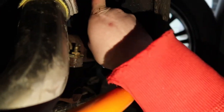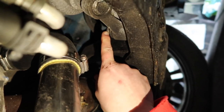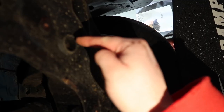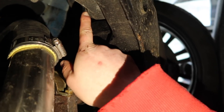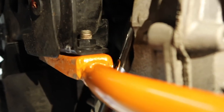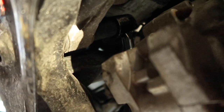With the under tray off, this is the bolt that we need to remove on this side. We are actually replacing both sides of these bolts because this bolt goes through here, down through the subframe and finishes in this hole area. The new one will be longer, coming out further so that we can put our brace on and have something to get the nut onto. These are torqued very highly from the factory, so I've got my breaker bar going in with a 15mm socket on that bolt. I've tried it from various different sides and this is the best angle I can come up with.